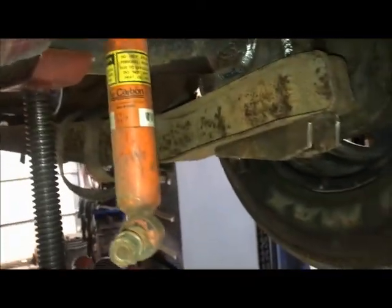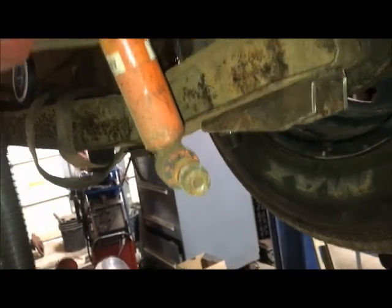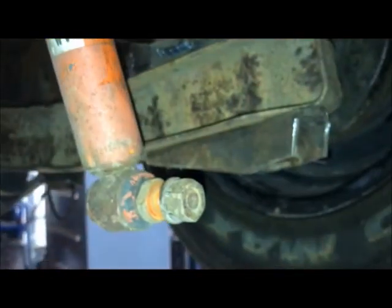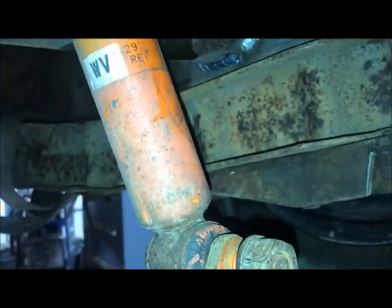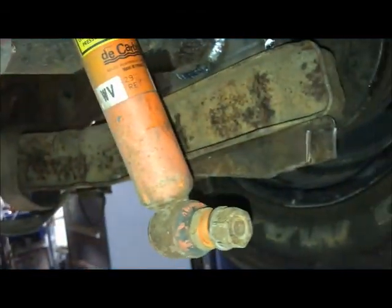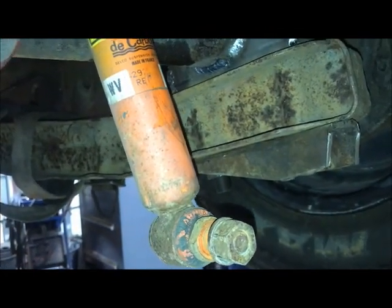This shock absorber extends way down past the rear axle. But I could make something like this at a little angle. Put a piece of steel plate up here at the top to hold the stud, and put something off of that original truck arm shock bracket to hold it. Compress the shock a couple inches and set that up.